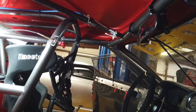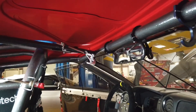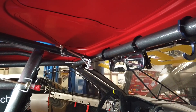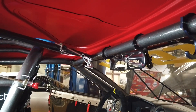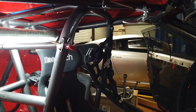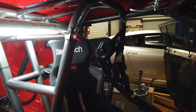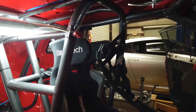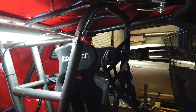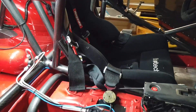As you can see up top, that's where we decided to put our parachute release. It's the most natural position for me — just reach up and slap it forward. Same thing for the fire suppression: that's the most natural spot for me to work it. A lot of people who have driven cars with this style cage mount the fire suppression right there, so you just reach up along the bar and pull it forward. And if you're on fire, hopefully it puts it out quickly.